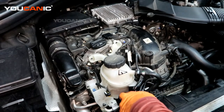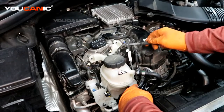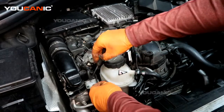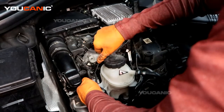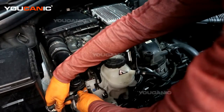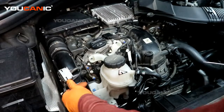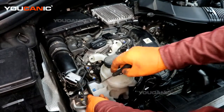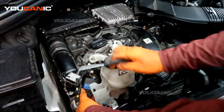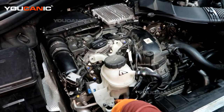We want to move the vacuum lines out of the way. Going around, we have one black connector here that just holds that cable. There's one up top, and one down here we'll get after we undo this. We have a connector to pull off the plastic, and then another one where we pull up the tab. We get that connector off, and then this one you need to spin — there's a blue tab, spin it to the right and it comes out. With that out, there's another T25 at the bottom of this plastic to undo.